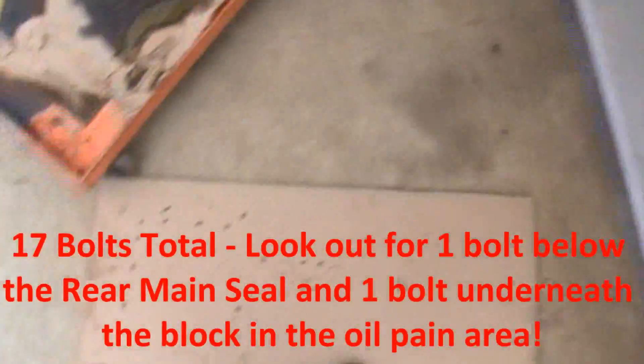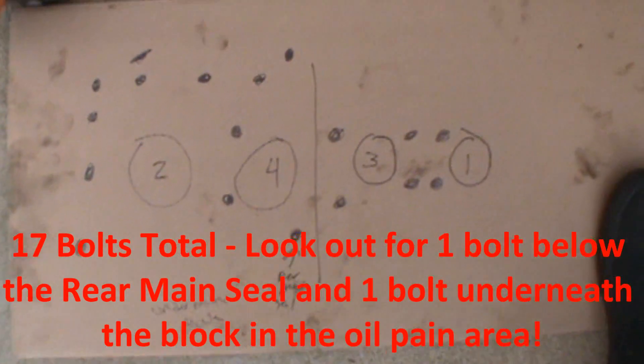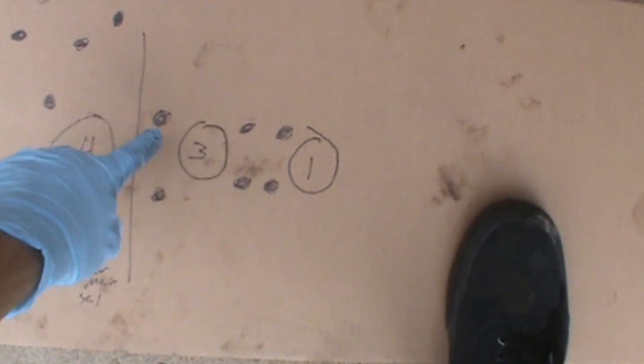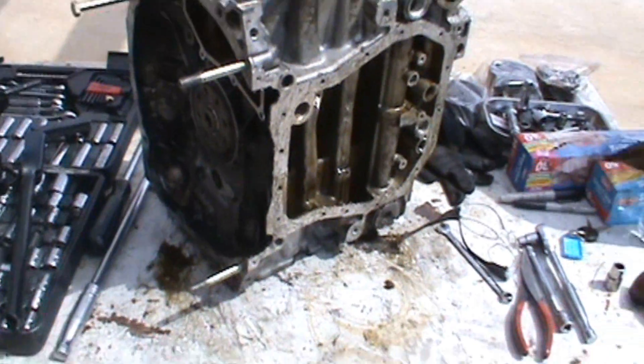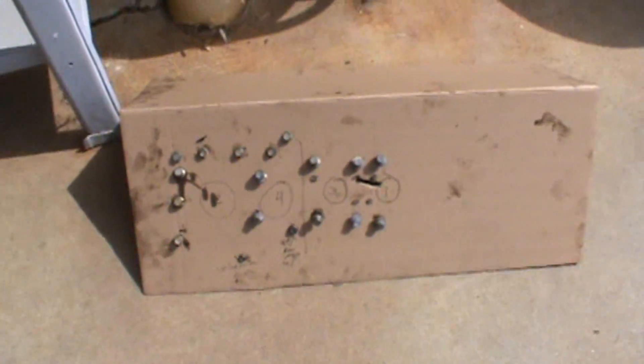What you want to do is organize the bolts. As you can see, I made a chart. On the 1 and 3 cylinders, these are the bolt patterns, and I'm going to stick the bolts in the holes so they're all aligned. Use the breaker bar and let it go. I got all the bolts out of the block so I can separate it — got them all organized here.